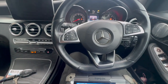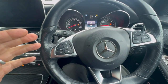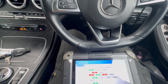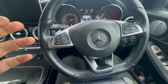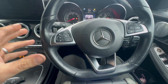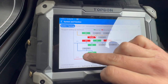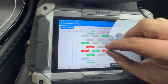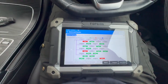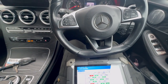Just got back from the road test — drove absolutely spot on. The washer warning light was on the dash before, so I topped the washers up and checked the sensor in the bottle — common issue on these Mercs — but it was just low fluid. Did about 10 miles, drove spot on, no warning lights came back. Sometimes this fault can clear for a long time, so it'll need a bit longer to be 100% sure, but I'm pretty confident it was the knock sensor. Done another full diagnostic scan — engine ECU is nice and clear. If you liked the video give it a thumbs up and subscribe — thanks for watching!